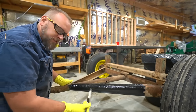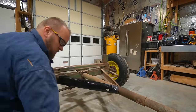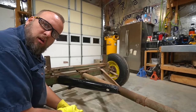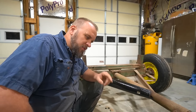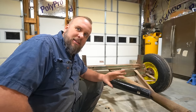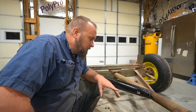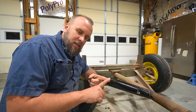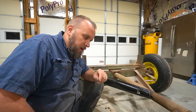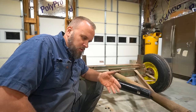We've got a coat on the side where we used the rust remover, and on the other side too. Now we just have to let that dry. As I've been waiting, I've been watching more videos about POR-15 and everything sounds like it's a great product. A couple of things I learned: paint thinner and mineral spirits will not clean this off a brush — I had to throw the brush away. Also, you have to do two coats and it takes two to six hours to dry, so I'm only going to do one coat tonight.